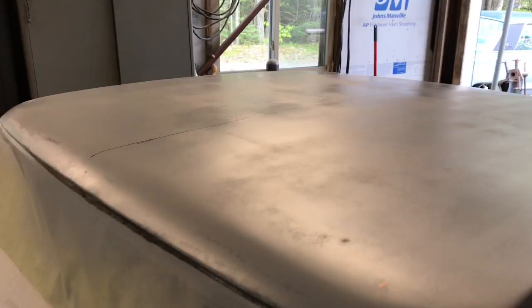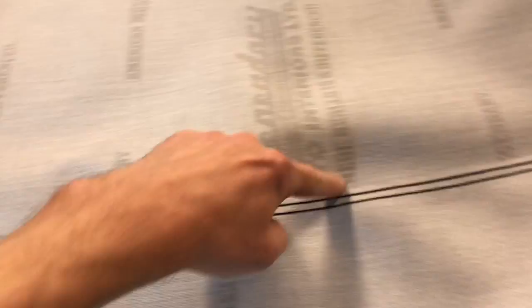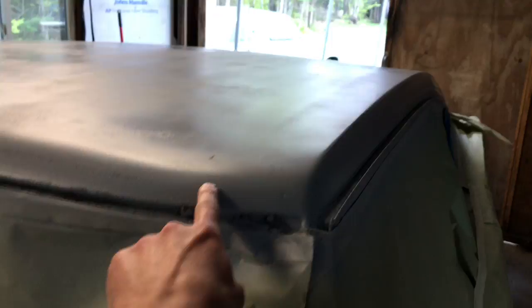And then we have other marks, which maybe you can't see, but they relate to these seams. And so when we go to spray this on, we'll actually mask off the roof to that mark, and then we can spray right to here, and you'll see as I do it, so that you don't get more glue on than what you need, so that you're not sticking down in the spots you're not ready to stick down. So, we're gonna mask off on that line, and get the roof back up on there, and show you what happens next.